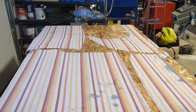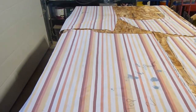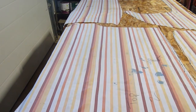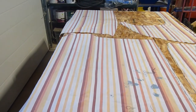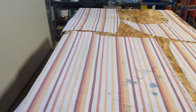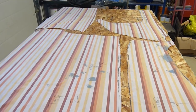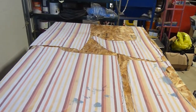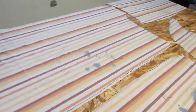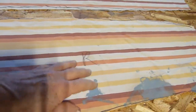The camera decided not to tape everything yesterday, so I'm running back to show you how I did it. I used this material with a strong pattern — something I had lying around with no future use. One advantage is that it's not stretchable and has strong lines, so you can see if everything is straight. I laid that on top of the headliner material, marked it carefully and lightly with a felt pen, then cut the material out, laid out to minimize wastage. I've labeled each piece to its location in the car.